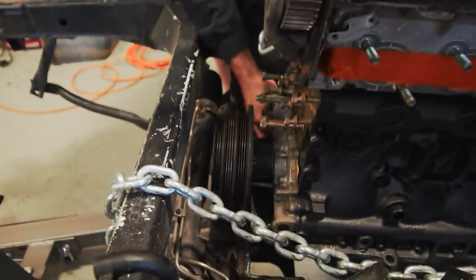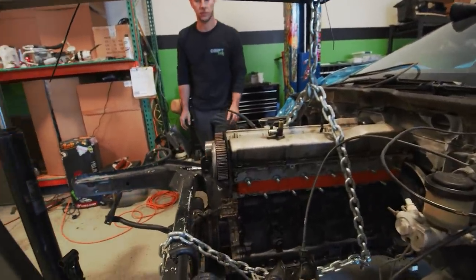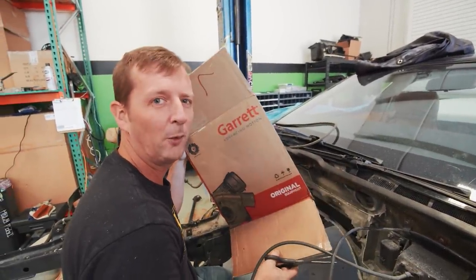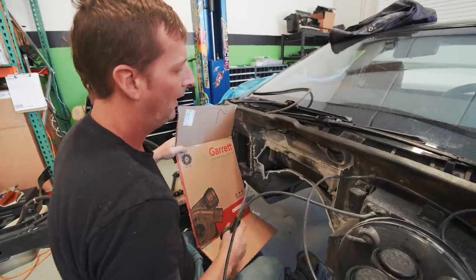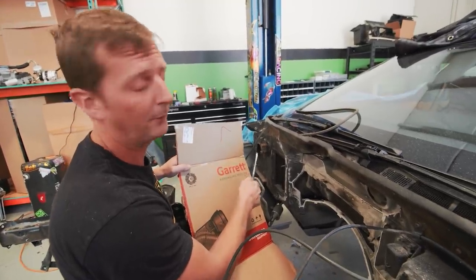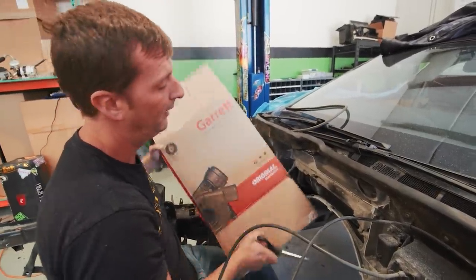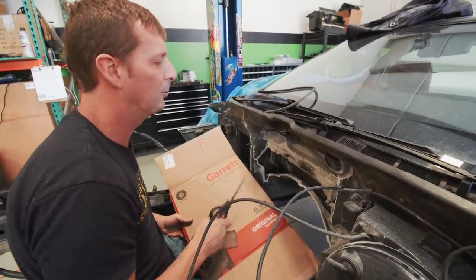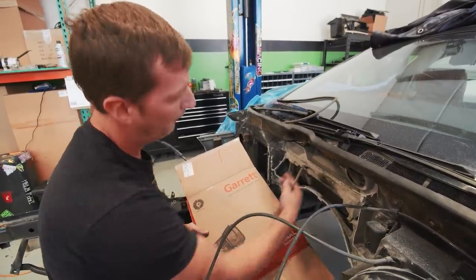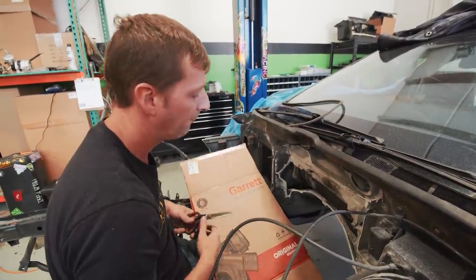This stupid bracket, whatever the hell this is for, is in our way. Can I come up with the motor just a hair? Because now our crank pulley is sitting on it. So I'm using a Garrett — this cardboard is sponsored by Garrett, hopefully our turbo will be too. I'm doing a block-off plate for the firewall and then another block-off plate where the heater core and blower motor and everything for the AC used to be. We're not doing an expansion tank, but we are doing a catch can there — fuel pressure regulator, all that fun jazz. Currently I'm just making a template — CAD, cardboard aided design. Then I'm going to make it out of aluminum, cut it with my plasma cutter, grind it all down, make it nice and smooth, mount it onto this firewall. We'll end up RTV-ing it or using some black silicone to seal it off so none of the water comes down. And we're going to do another plate that blocks this all off so the water actually drains out through the sides how it's supposed to, and not onto the back of the valve covers.